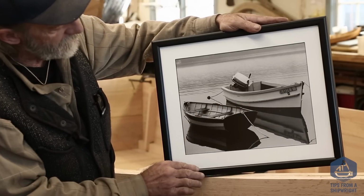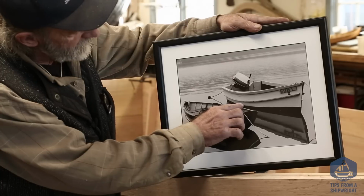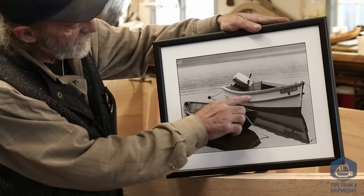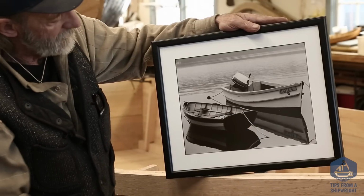He's still building skiffs, and this was built quite some time ago. And you can see right here that it's got the lift rails on it like I'm describing. They're a little bit higher than the ones I'm going to put on. I think they put them up this high right here because they're well above the waterline here, and that way they don't foul up on the bottom. But when you paint the boat, you paint that rail just like you would paint the top sides the same color, and it's painted above the rail and below it.